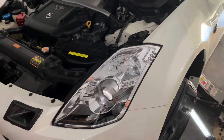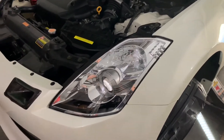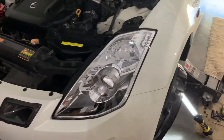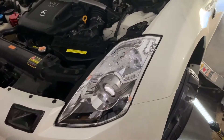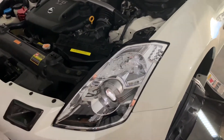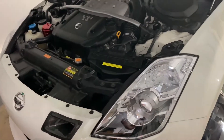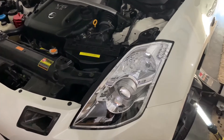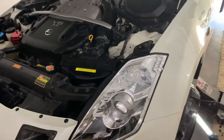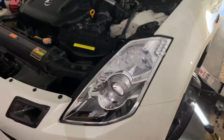What we're going to do is mod the bulb — and when I say mod, it's using some electrical tape. I'm going to use the tape to cover up two of the four prongs. Those two prongs are what the adapter reads to come on with the parking lights. What the electrical tape does is just cover those up so when you turn your lights on, it sees like there's no bulb there. The other two work just fine with your turn signal.